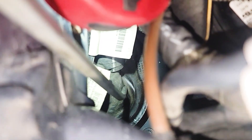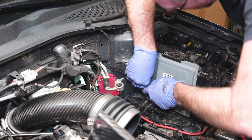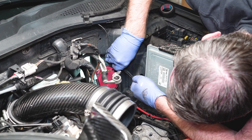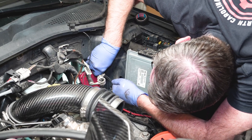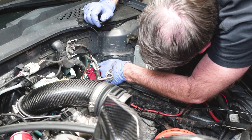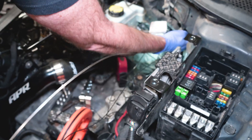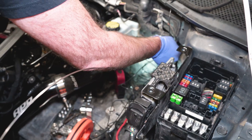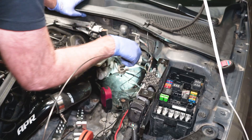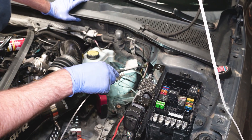With the tray out you can see better — we're going to go back here underneath where the battery tray would be and you can see where the wiring goes into the firewall here. There's a boot back here, so we're going to take our big pointy thing and stab a hole through this grommet. I stabbed the hole and I'm lining the wire up with that hole, then poking it on in. You could use a coat hanger honestly — this is something you could definitely do with things you have in your house. Just find your hole and feed it in.